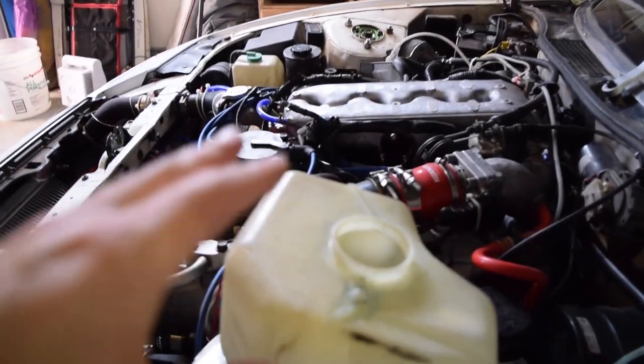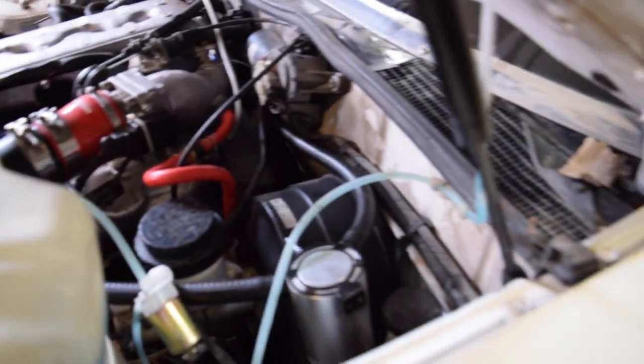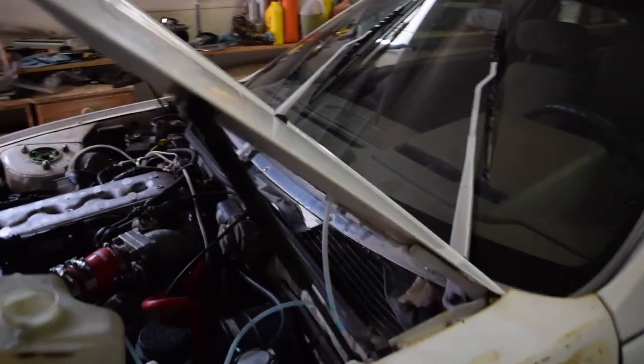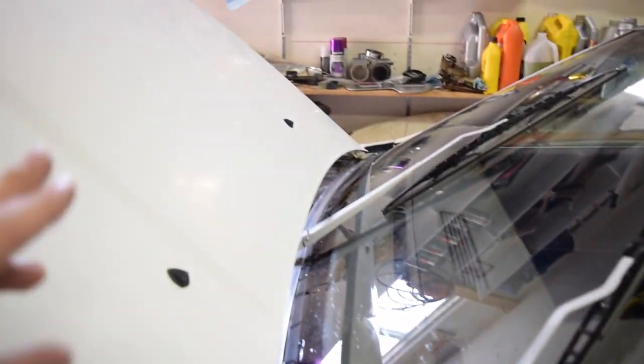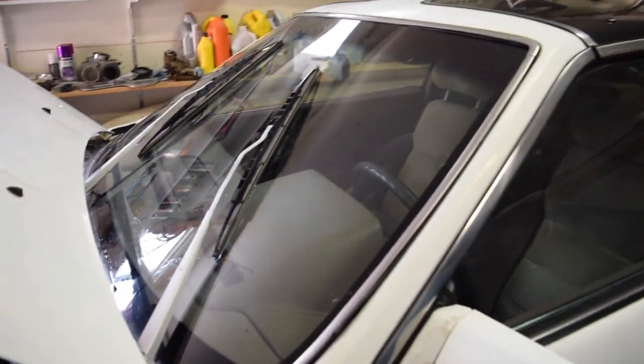Alright, I went ahead and put the reservoir right there — got that coming out of the bottom and going up into the hood. And if you can't tell, there is a little bit of water on the hood now. It only came out of this side so far — I think it's just because the entire system hadn't actually primed yet, so that one has air in it still. But other than that it worked and I'm super happy about it. It had a very strong spray. Obviously my hood was up so it sprayed right here, but it should be able to spray the entire windshield properly.